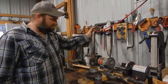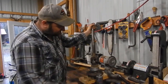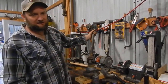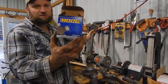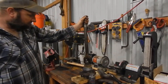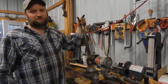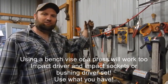I've got this U-joint on this side and ready to put it back in. I've already put the shaft in the other side, and on the band right here I put a little anti-seize to keep them from corroding and rusting in the future. I didn't have any problem on either side taking it apart, so I was fortunate for that. The reason I'm putting U-joints in is my brother just purchased his truck and the U-joints were worn — clacking, making all kinds of noise. The part we used today is a Moog Super Strength part number 377, which is supposed to be a lot better than the original equipment U-joints. There are different ways to do this: you can use a 2x4 or 4x4 post, take a hammer, strike the yoke, knock them out and put them back in — but that's not the way I like doing it. My preferred method is using the C-clamp ball joint press kit.